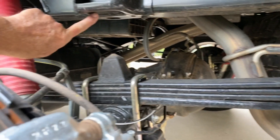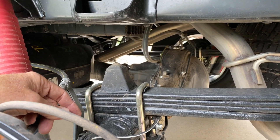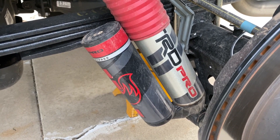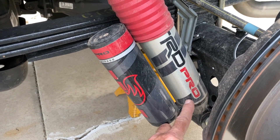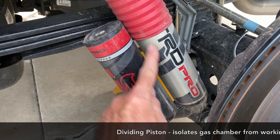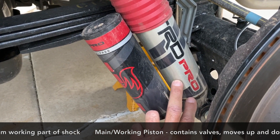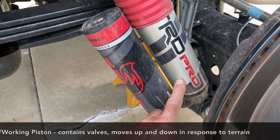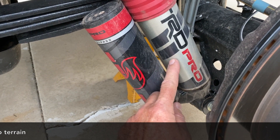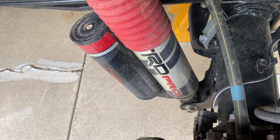Here's the bump stop and this is the landing pad that it hits against when you bottom out — and you will, because it's a truck. It's easier to see the rear shock and how it works back here. Normally in a monotube shock you would have a gas chamber in the bottom with a dividing piston, and that would shorten the effective usable length of the shock. But when you make a remote reservoir, you can move that dividing piston over here and put your gas chamber at the top — extra oil for extra cooling, and extra length to allow your shock to have more usable travel even though you haven't changed the length of the body. Those are two benefits of having a remote reservoir.